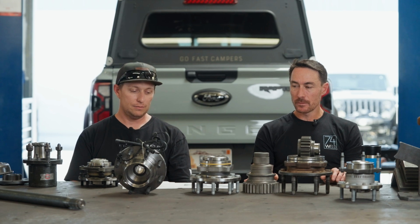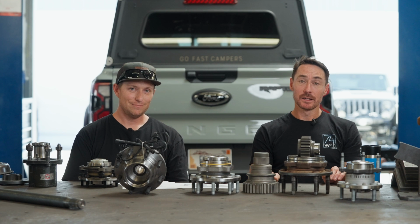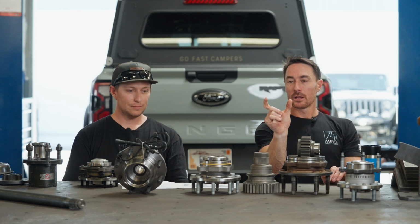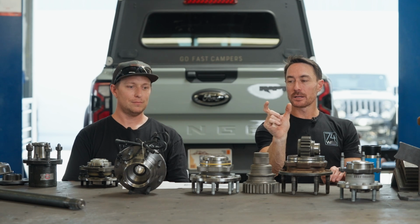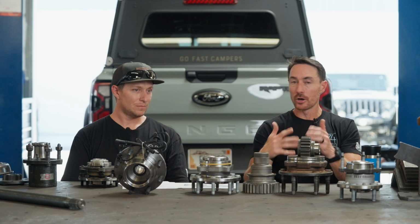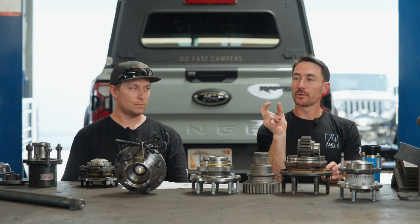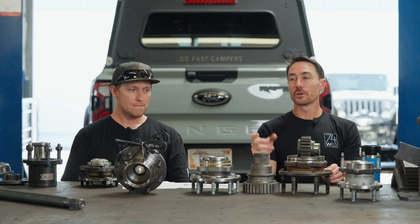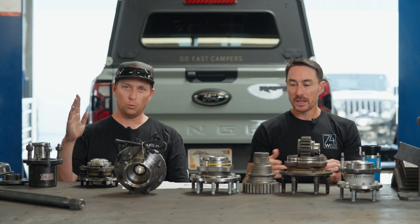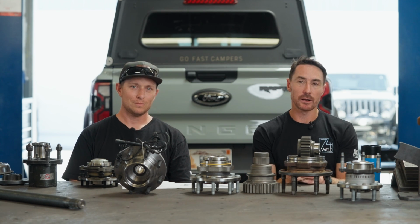And the con with that is that it's wide. It's going to be very wide because those dual row bearings are like that wide, and then your hub has to register against that to add the load. It's not preload to the bearing pack because all you're doing is pinching that inner race. But that's how you're constraining that bearing in that application, and keeping your wheel constrained laterally. And that's wide. There's just no getting around that.